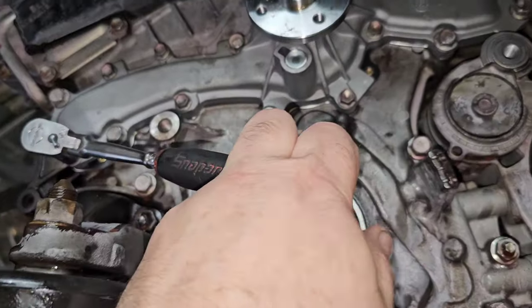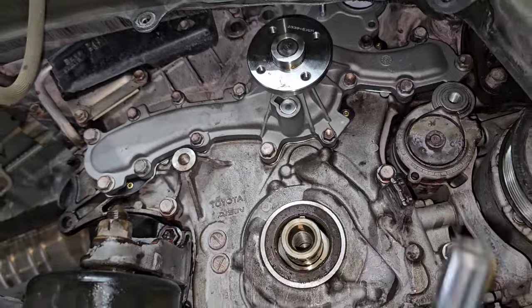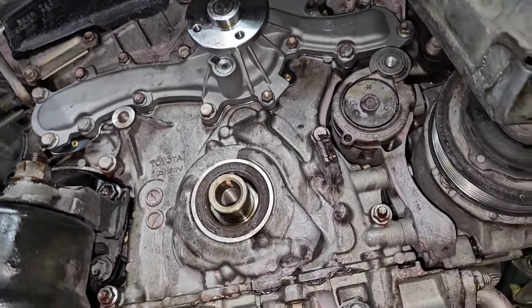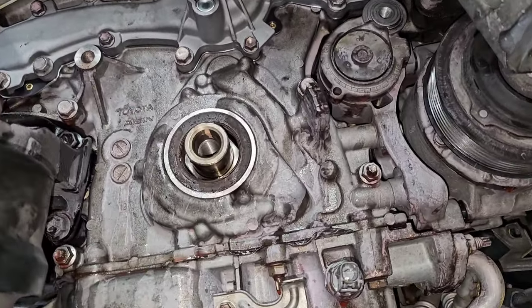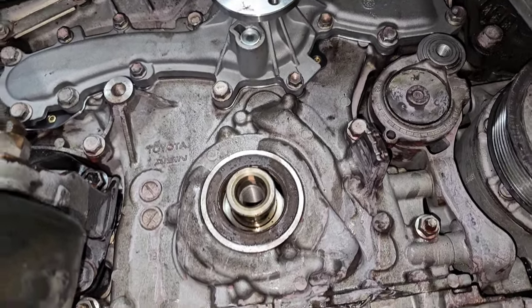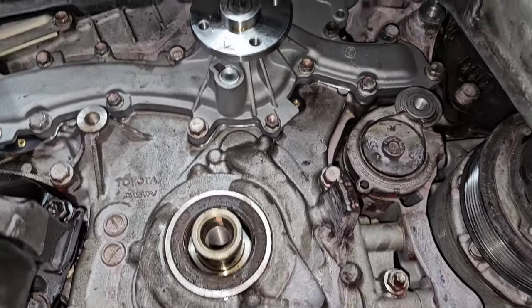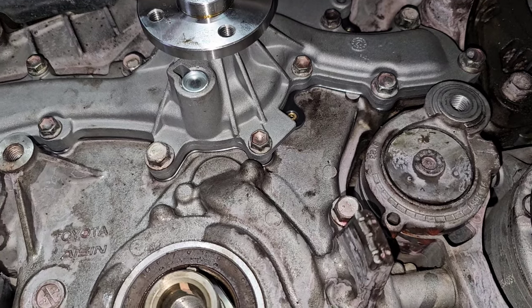I brought them all down by hand — that was the last one there, so everything is good. I made it good and tight by hand; I'm not going to stick a torque wrench up there. Use your brains when you're tightening it up. I also pulled the harmonic balancer off — it was just a big center bolt and then the whole thing slid off. Didn't have to use a puller or anything. I just did that to give myself a little more room. That's actually going to wrap it up for today — I'll get back on this tomorrow morning.